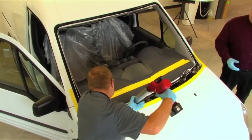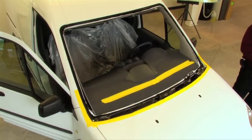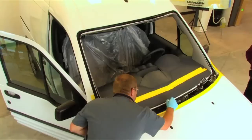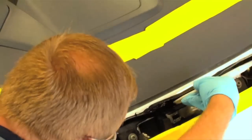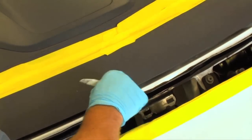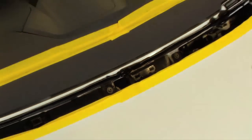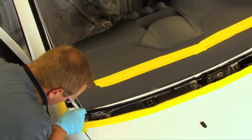The product we're using is polyurethane — a moisture cure product that cures by absorption of moisture. You'll notice Buzz is wearing gloves throughout the process, because urethanes have some very nasty chemicals and you want to protect your hands at all times. Here Buzz is using a fiber stick to paddle the seams. He goes one direction on one side and the opposite direction on the other side — you don't want to go back and forth, as that can pull the urethane up and off the pinch weld.